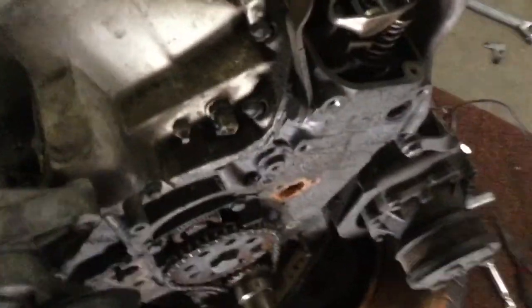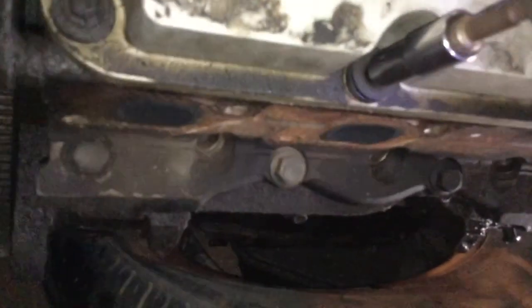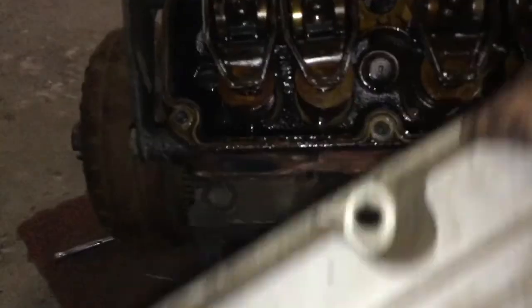To get this off there's a bolt down here and a bolt behind here, but I don't have anything to go in there. So I'm just going to try rattle gun the bolts off the power steering pulley. I'm kind of pissed about that because I wanted to get that intake off - cause then I can't get the heads off because these bolts are in here. That's a 10mm, 10mm, 10mm, 10mm - I think there's actually a 10mm there too. That's not that bad.